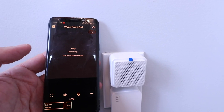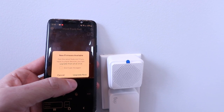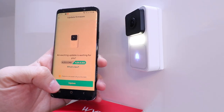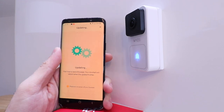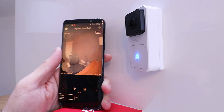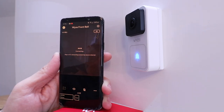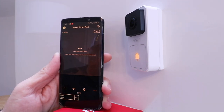It says failed to connect — just press that again. Typically it needs to upgrade the software. Click upgrade now and this will take a minute or two. The doorbell will show offline during the update. You'll know the update is getting close to done when the light changes from orange to flashing orange, and then finally goes to the blue status light, which means everything is good to go. Overall it took about two to four minutes for the doorbell update to complete.